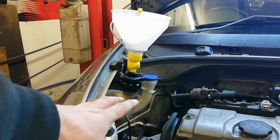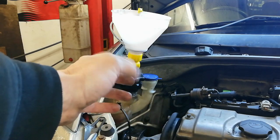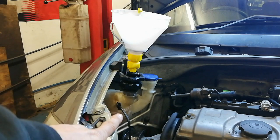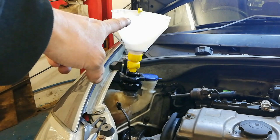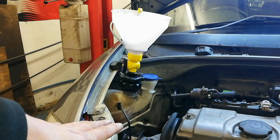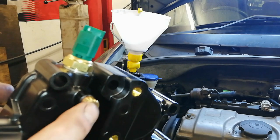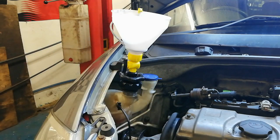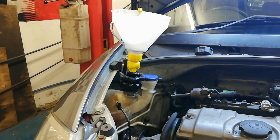When it says spill-free, the coolant will expand and rise up into the funnel instead of spilling all over the place. When you switch the engine off and it starts to bleed, it'll settle back down again. On this type of engine there is a bleed screw on the flange and also a bleed screw on the heater hose at the bulkhead, and you can use those to help get the air out.